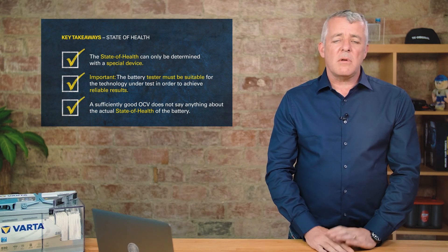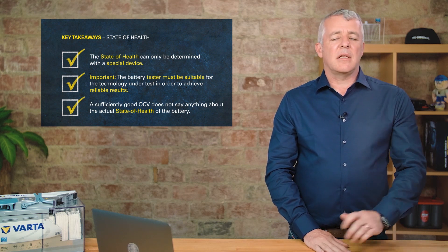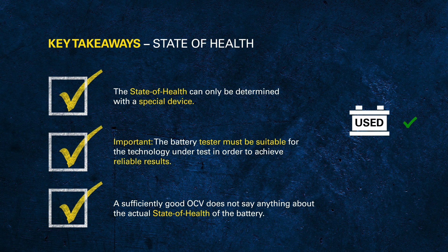It's important that your battery tester has a printer. Once you print the results, make sure they match the standard shown on the battery. Battery testers are designed to test used and cycled batteries — therefore they should not be used to test new batteries, for example batteries coming into stock.